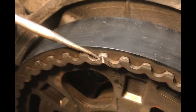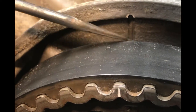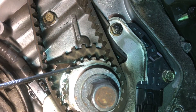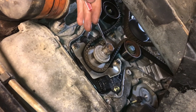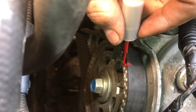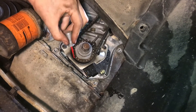Before we really start pulling all the tension off and removing the timing belt, make sure all of your timing marks are lined up. The top one on the front camshaft gear has this timing mark lined up with the mark on the casting, and on the rear camshaft I also have those lined up. Down below on the crankshaft gear there's a timing mark on one of the teeth that you line up with the arrow on the casting. I needed to rotate this gear twice before both timing marks on the top lined up. It's important that both camshafts on top line up with their corresponding timing marks. I'll put a little marking paint on the gear and on the belt so when I put the new one on I can transfer these marks and be sure it's going on correctly. I'll put three marks on the bottom crankshaft so I know I can't get them mixed up.